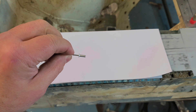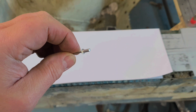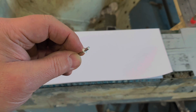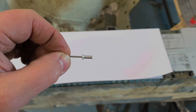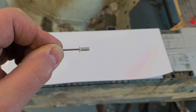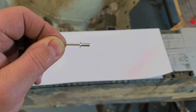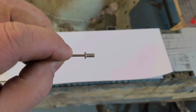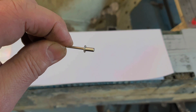These are two of the rivets we're going to use quite a lot on this build. That is an eighth-of-an-inch (3.2mm) countersunk closed-stem rivet — it's capped at the bottom, so if you're working anywhere with potential water ingress a closed-stem rivet is always a better bet; nothing can get in to set up corrosion. It's countersunk so we'll use those on the inside of the cabin with no sticky or bubbly bits. The grip length — the distance from under the head to the end of the rivet — must be chosen carefully: it's the thickness of materials joined plus one-and-a-half diameters. Another rivet we'll use a lot is an eighth-inch closed-stem non-countersunk version — and it's stainless, made by Pop, so it's a genuine pop rivet.